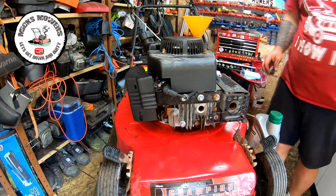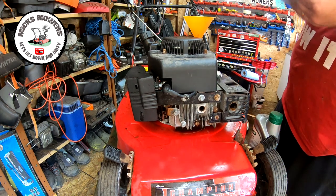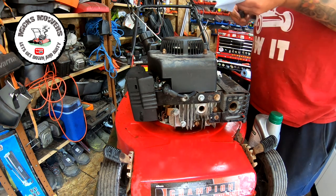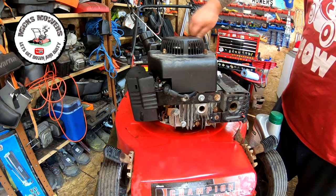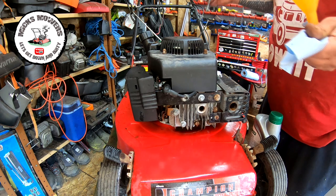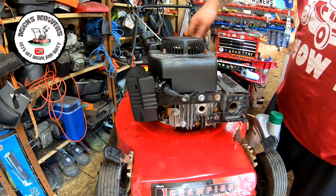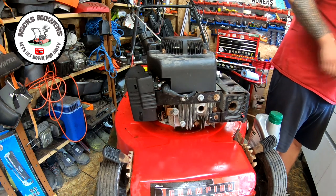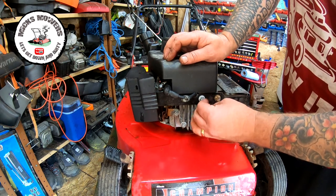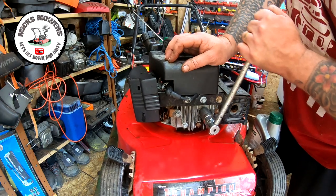I'm going to put about 300 to 400ml to begin with, see how it gets on. Because it's been filled up with water, I'm going to take it outside and start it — this is going to smoke like no one's business. I've got a new NGK spark plug to go in, which is the right one for it. So I'll just let that top off, get it up to about the right level, and we'll see how we get on outside. I'll also just undo the carburettor 10mm bolt to take any water out of the carburettor for now as well, just to give it half a chance.